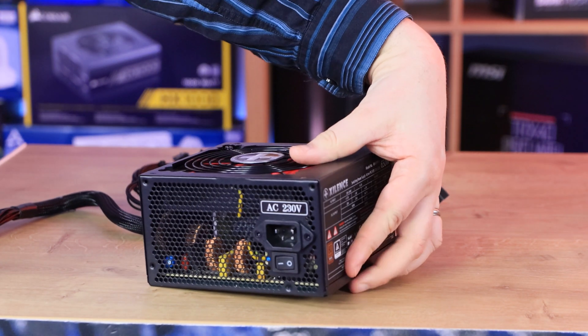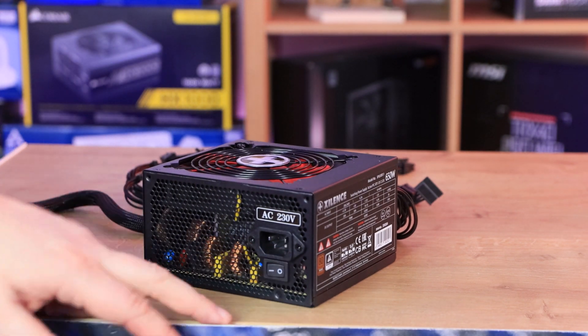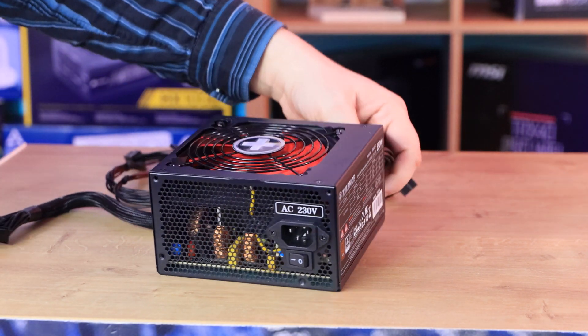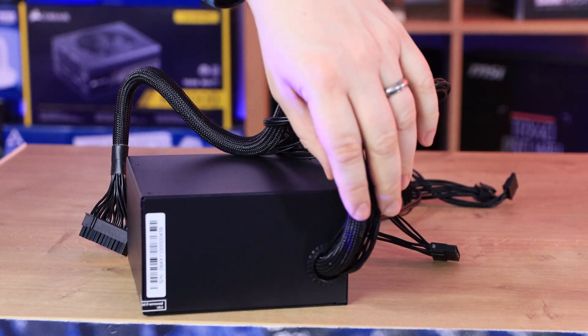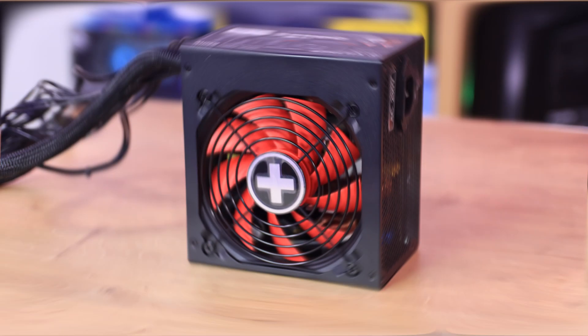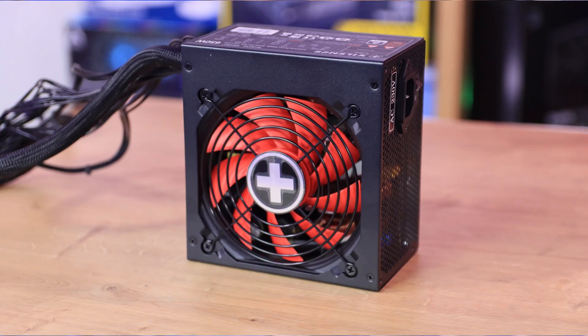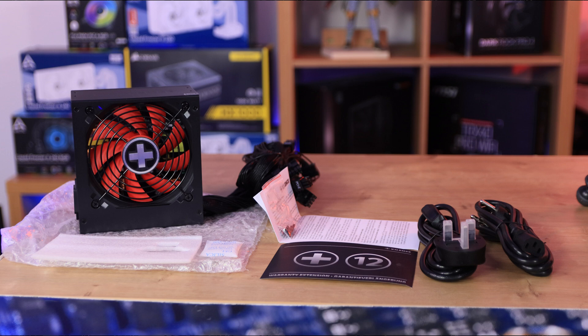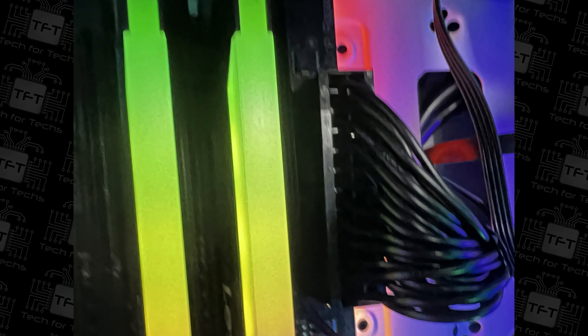On the back of the power supply itself you can see the grill, where you plug your power cable in, and you've got your rocker switch — pretty straightforward. This is a non-modular version, so it has no extra connections on that side. Bear in mind there are some versions of this which look very similar with similar names — some are modular and some aren't. If it's got the letter M in the model number, it means it's modular; if it doesn't, then it isn't. It can be a bit confusing as the paperwork makes it look like they're all modular, but there are asterisks noting certain ones are not.